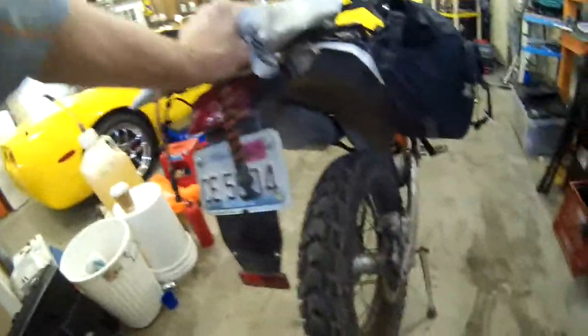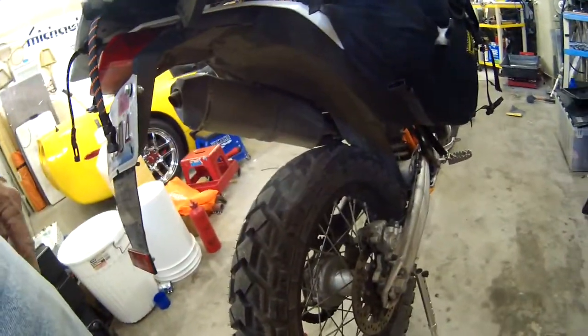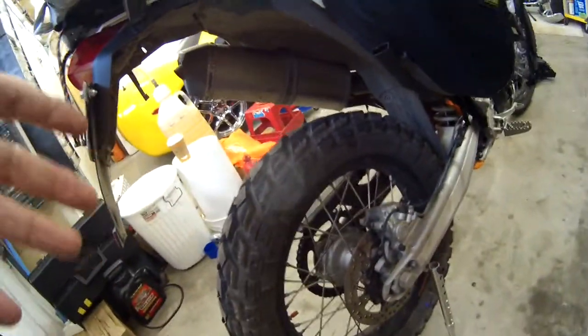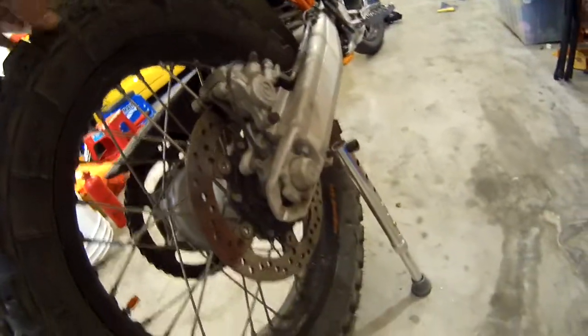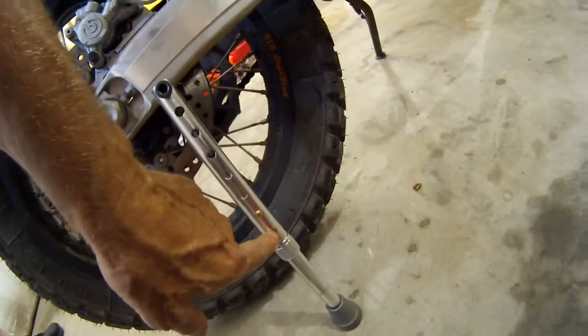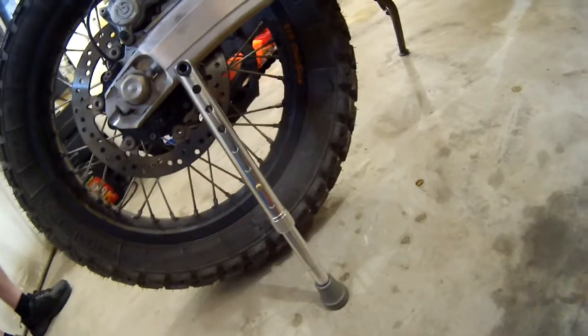That's super spiffy. Because you've got the front wheel locked, if you try to push it, it doesn't move. So you can come here and lubricate your chain, or probably take the wheel off if you wanted to. On a KTM, you'd just unbolt this, unscrew that, and the entire axle slides out this way. Then you push it forward to take off the chain, and slide the whole thing back outside of the brake caliper. It looks high enough, but if you needed to, you could move it up one more notch to give yourself a bit more clearance if you're sitting on gravel or uneven ground. That's a very clever idea.